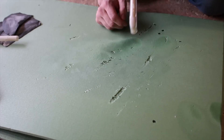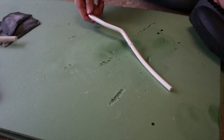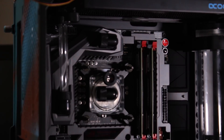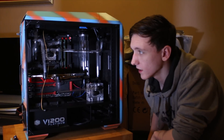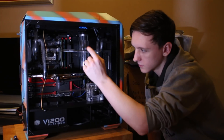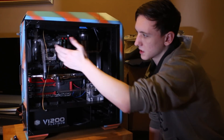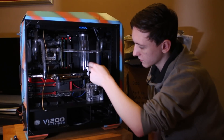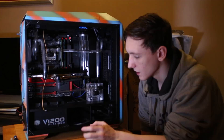If you've got any questions on bending or hard pipe water cooling, feel free to let me know in the comments and I'll try to answer them as best I can. So here's my conclusionary piece: we've got the pump connected to the graphics card, graphics card to radiator, radiator to VRMs, VRM to CPU, CPU to front rad — with a bit of bubbling — front rad to reservoir, reservoir to pump. That's pretty much the circuit.